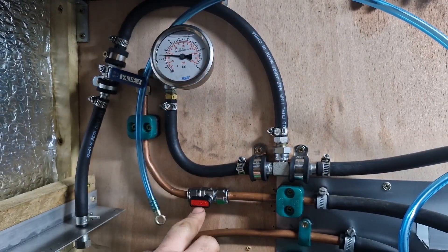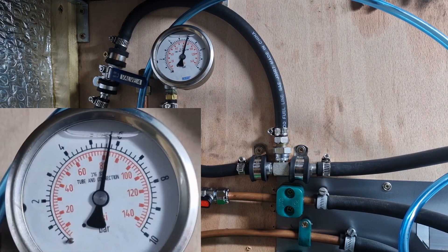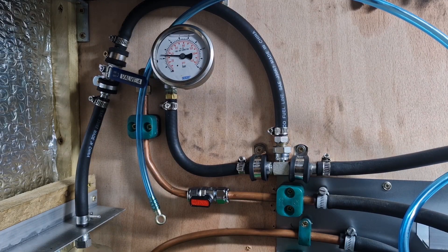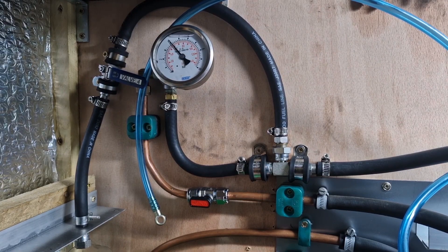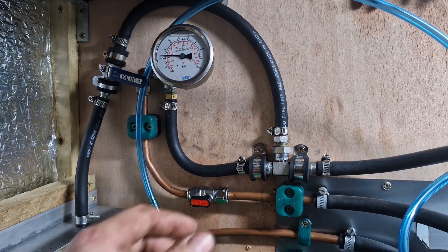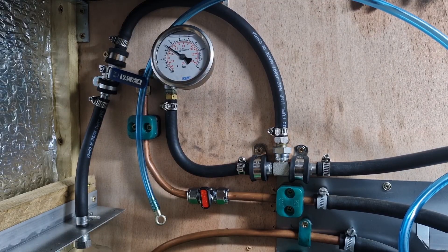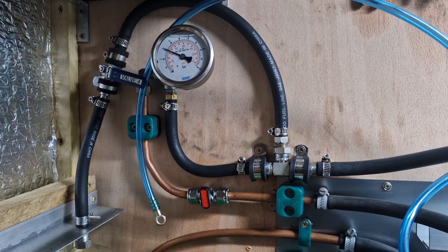Let's look at the gauge. The tap is open, which gives us our system pressure — we have 6 bar on this one. Notice how quickly KE-Jetronic gets to system pressure; that's because the fuel pressure goes straight through the fuel distributor to the pressure regulator. Now closing the tap, we're looking at differential pressure — slightly slower. We're at 5.6 bar, so 6 minus 5.6 gives us our 0.4 bar differential.